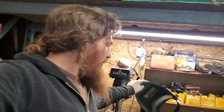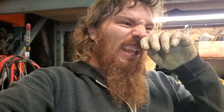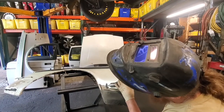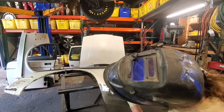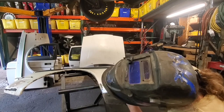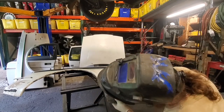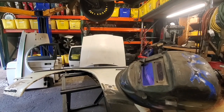As you can see, I've donned my welding helmet. We've been doing our first official bit of welding work on the car before we get it out for the paint shop. I made a couple of executive decisions after looking at the car and talking with my paint guy. The later model 240s that came after the 85-86 era had all that plastic down the bottoms of the doors, the bottom of the rear of the body, the rocker molding and all that. Since we're doing a homage car, those don't have any of that, so I've gone ahead and deleted the rocker molding and the plastic off the back half of the car.